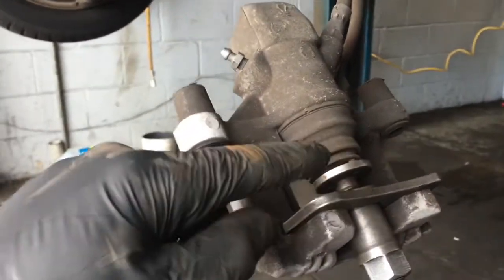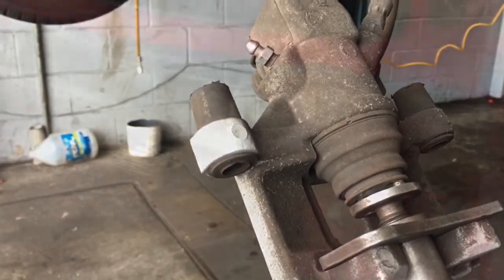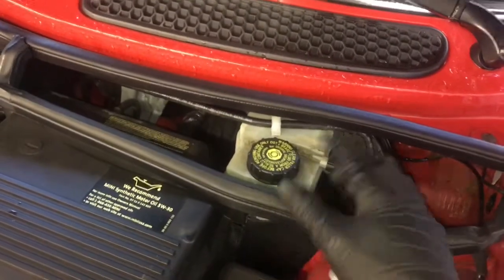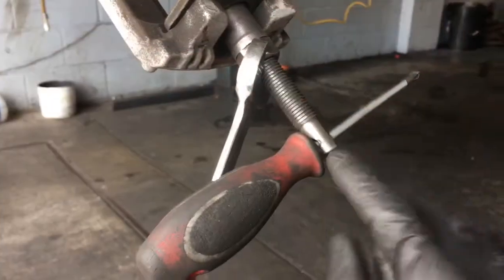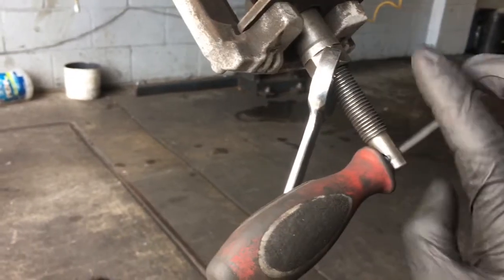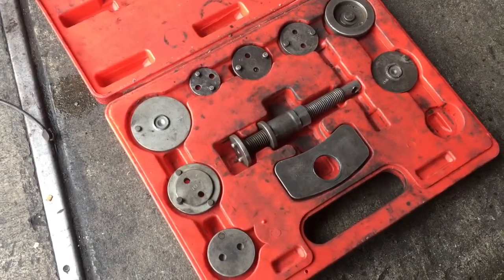Leaving the bleeder closed is going to push the brake fluid back up into the master cylinder, so you need to remove a few ounces of brake fluid so it doesn't over-spill into the engine bay. I'm going to take a little turkey baster and suck a few ounces of brake fluid out, and also check the condition of the brake fluid while doing this. I recommend going in small quarter turns clockwise, then backing out counterclockwise a quarter turn, and repeating until the piston is flush. I will link this tool up in the description of the video.